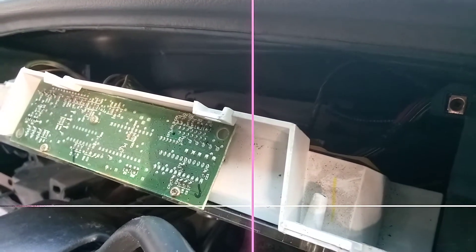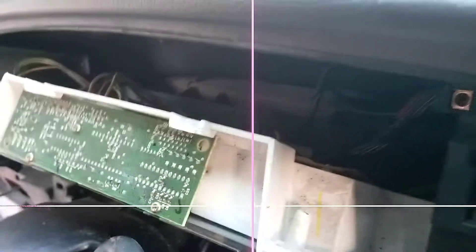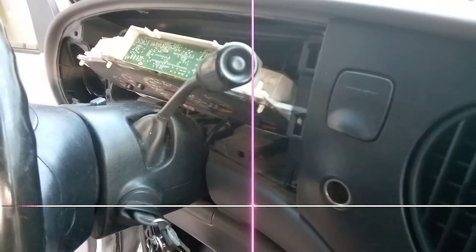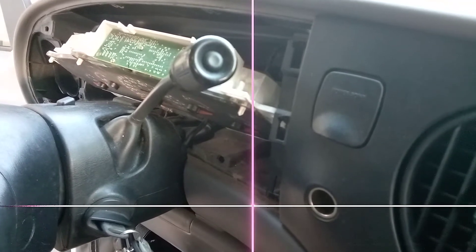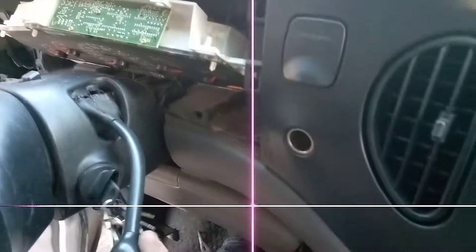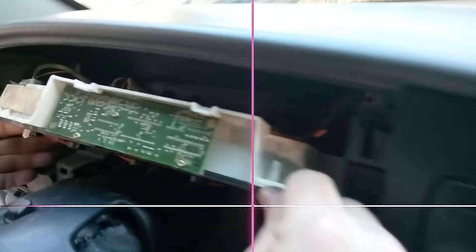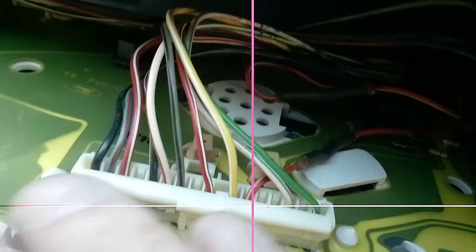The alternator voltage regulator is probably Chinese and it malfunctioned, or maybe two of the windings inside the alternator fused together from heat. Whatever the situation, it caused serious electrical problems and it even burnt up a spot here in the instrument cluster, causing us to lose all of the gauges. You can see this on them — it caught on fire and burnt up like a cigarette lighter.